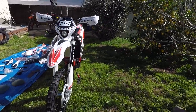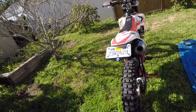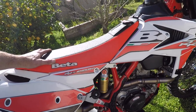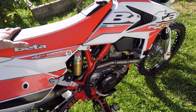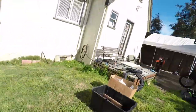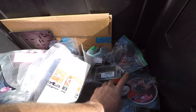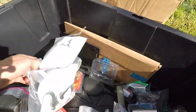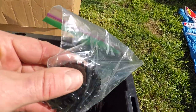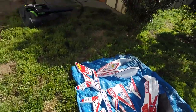But it's been meticulously maintained, right to the T. I just put a brand new clutch in it 2 nights ago and replaced the oil pump gears. So a brand new clutch, brand new oil pump gears. I did the stock plastic oil pump gears just because I don't think the steel ones are worth $200. The ones I pulled out are absolutely perfect. There's not a single nick or sign of wear on those oil pump gears after 7,700 miles. So I put the other ones back on it.